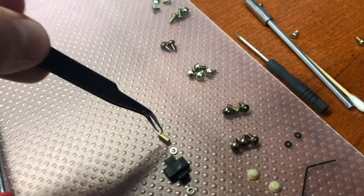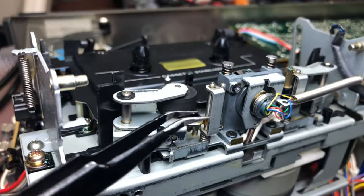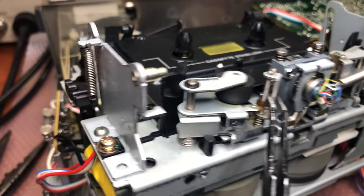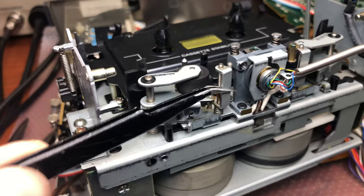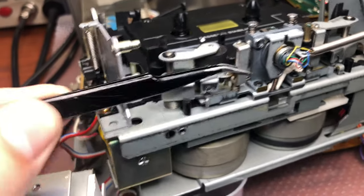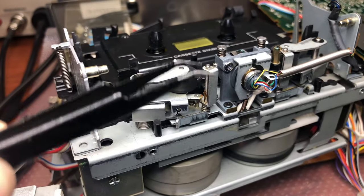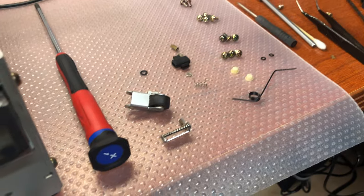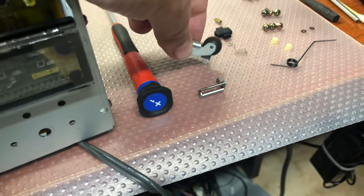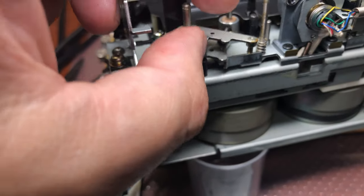Okay, so I removed the guide itself. To remove it, we need to unscrew this nut, then properly pull out all parts. We'll have this stuck piece — I can't turn it, it barely moves, and that's the problem. That's why this mechanism doesn't work properly. So what I'll do is slightly rotate it back and forth until it gets released, remove it, clean it up, oil it, and put it back. Then I'll repeat it with the second guide. To remove this guide, I also had to remove the pinch roller because it prevented pulling the guide up.